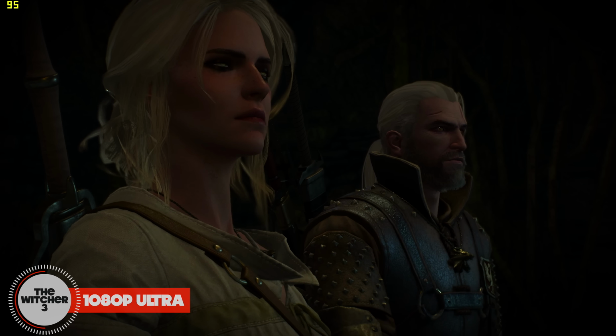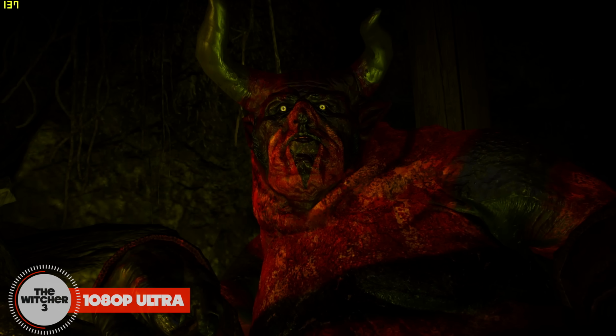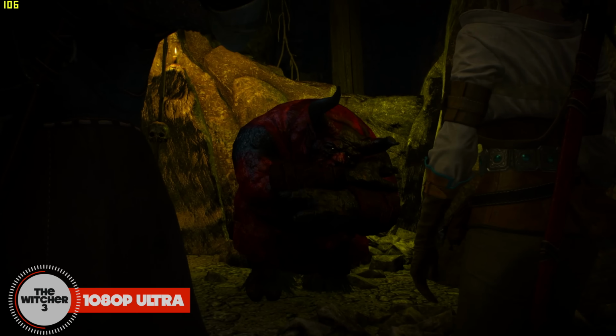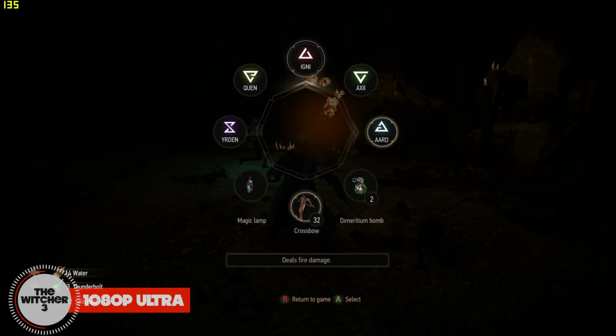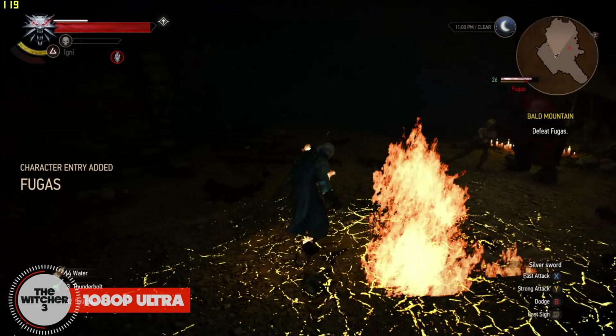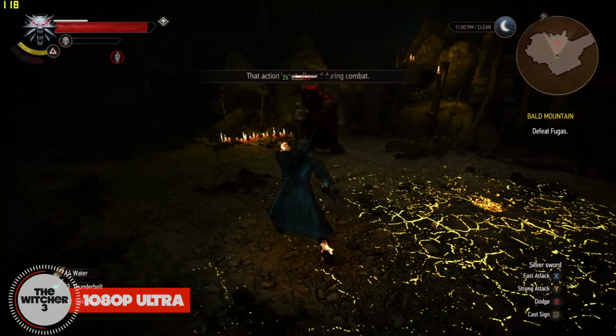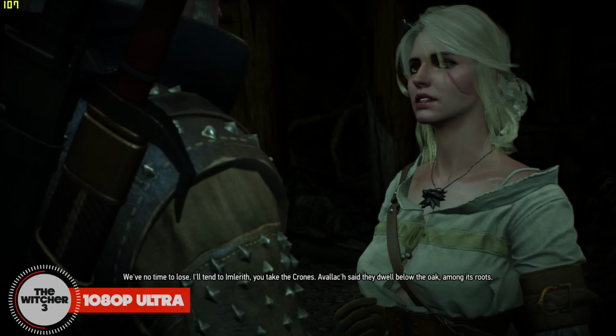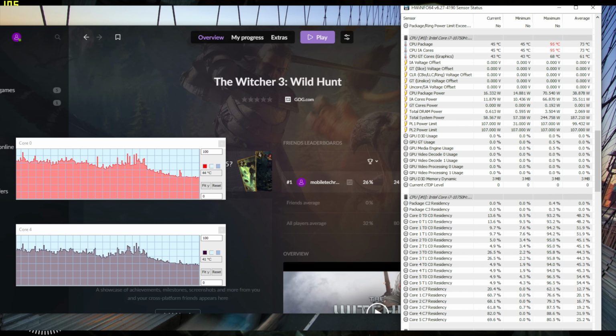So that said, it runs a lot cooler than the last generation. A lot cooler means by about 5 degrees centigrade, which is a pretty significant drop thanks to that redesign of all the cooling and internals. In some games, this is a bit more than that. In some games, not as much. It really depends a lot on how CPU dependent some games are. So, as an example, for something like The Witcher 3, which looks like it's kind of CPU dependent, it gets toasty, but not unbearable. Now, everything we ran, we did 1080p ultra testing. VSync is turned off, no frame rate limiting on these laptops, and DirectX 11, because DirectX 12 is still a little bit of a mixed bag in a lot of games.